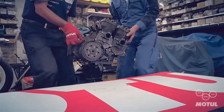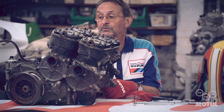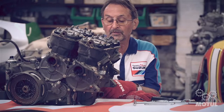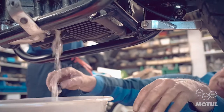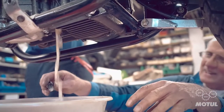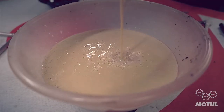We've just taken the engine out of the chassis in about 40 minutes, including time to mark the parts. But already, when we were draining out the gearbox oil, we realised it had been polluted by basically the radiator water, as we thought. We've saved the gearbox oil — or emulsion, as we call it.